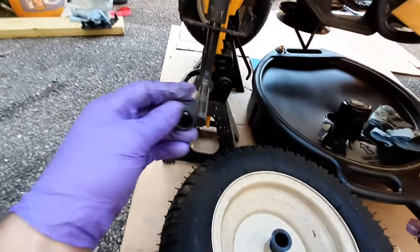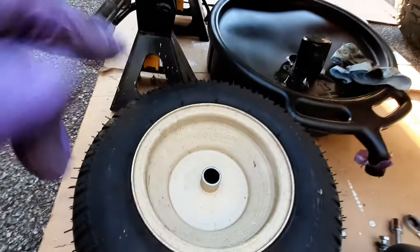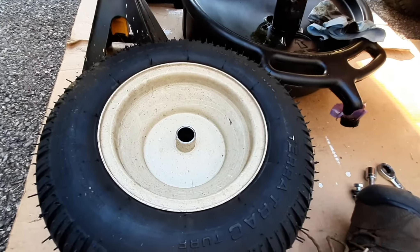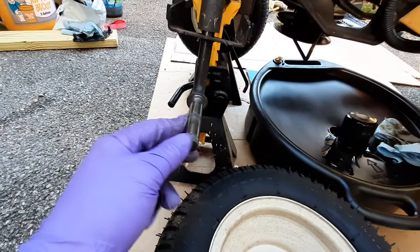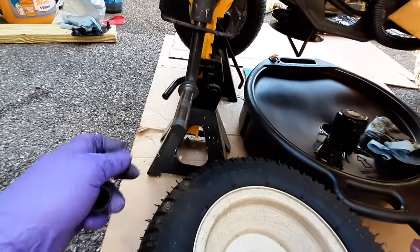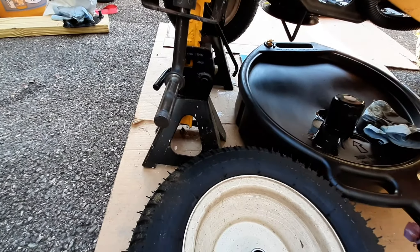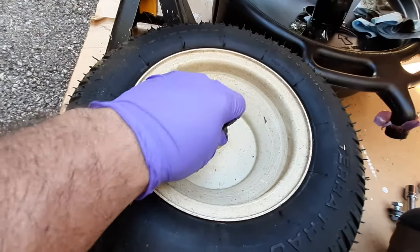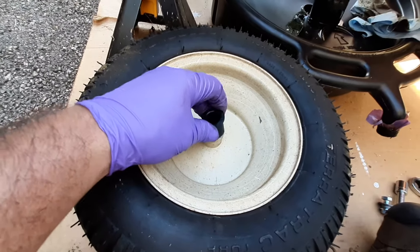And then they fit over the shaft good. So what I'm going to do now is take the shaft with a rag and get it cleaned up and lube it with just a little bit of 10w30, and I'll fully grease it later. For right now I'm just going to throw a little light oil on it, and press those down in the hub with a rubber mallet.